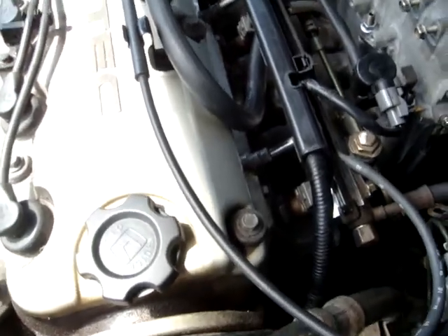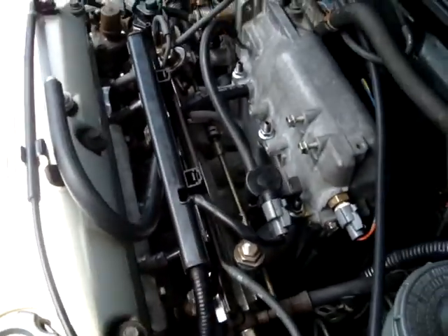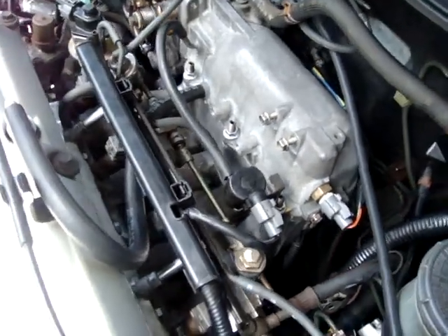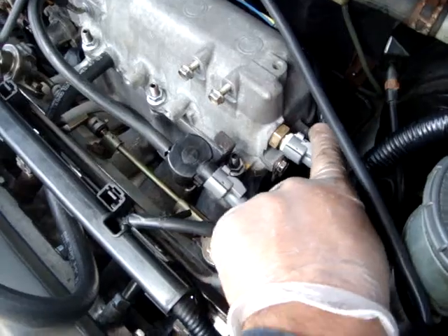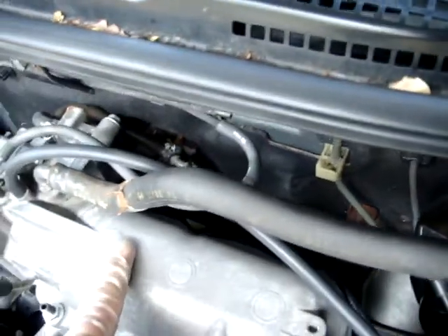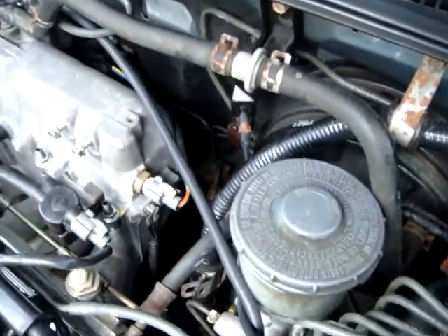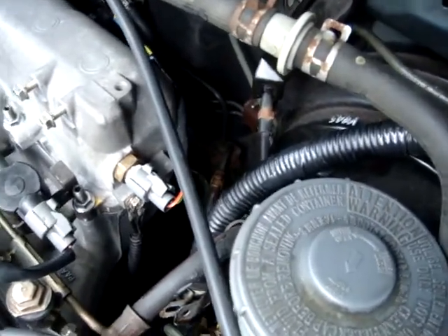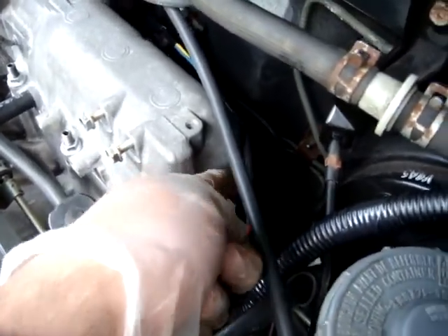You can't really see it, but your fuel rail from the B1 or the B2 will both fit. What you will have to do is extend the air intake temperature sensor — you can see I've extended it, probably about eight inches. I didn't extend it that much; it's a little tight there but I'm pretty sure it'll hold.